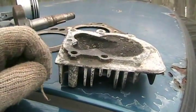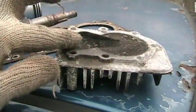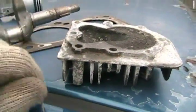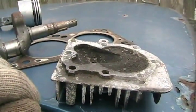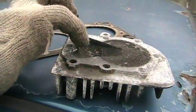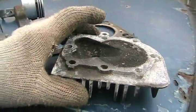Another thing you can do to increase horsepower, which is on the top end of the engine, is machine some of this surface off the head so that ridge would be shorter. That increases the compression ratio. If you've machined a little bit off here, this might drop to say 9 or 8 cc's, so you'd get higher compression. That's free horsepower.